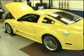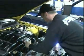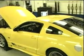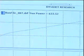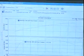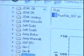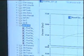After we finished dialing in the throttle body tune, we decided to swap pulleys, add a little bit more boost, put some race gas in the tank, and see what it would make on a race tune. What you can see here is we made 633 horsepower on the race tune with 571 foot-pounds of torque, done on just about an average of 15 pounds of boost. These horsepower readings are in SAE numbers. Over here on my run file, you can see this is the Jim 3 supercharged setup — I made a new separate file so it wouldn't get confused with my old naturally aspirated tune.